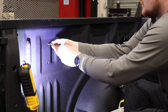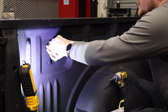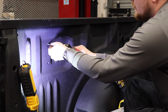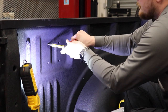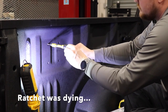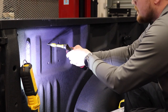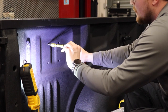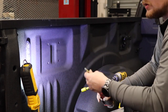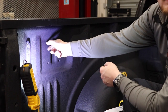Take your tap and get it in threaded one and a half or more turns — that way you know you're starting in the right spot. I got about four turns on that one. I'm just taking an electric ratchet and running it in. As you can see there's some material in there. Do that for all the holes, then take a bolt just to check it — nice and easy, like it's supposed to be.